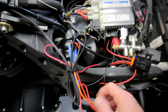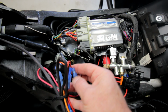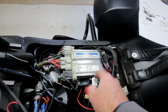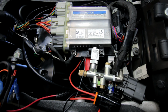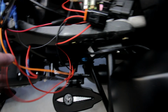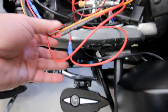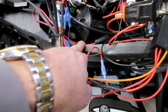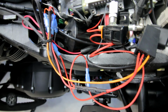It's grounded in there. And then you've got your controls coming out of here. You've got two red. This black goes to the manifold. This controls the valves, so it controls when you're going to dump or fill. And then the other power goes from the relay, connects up with the power to the compressor, and then also there's red power going to the switch up here.